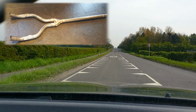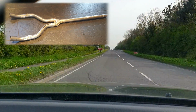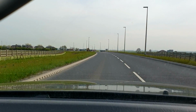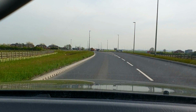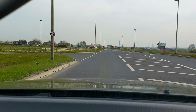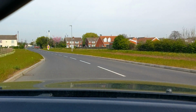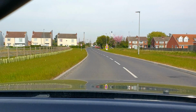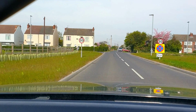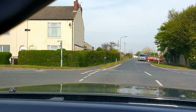And this was the exhaust I was going to use from the manifolds down. No cats, no resonators, no silencers, nothing. But it's 2.5 inches, and I think that's too big. I'm going to lose pressure, so I'm going to keep it the stock size piping to the turbo, and then 3-inch out the other side of that. I'm going to be using a splitter, so I can have it nice and quiet when I want, and loud and raucous straight out the turbo when I want as well.